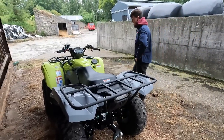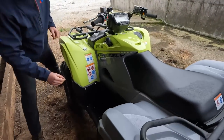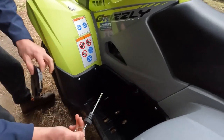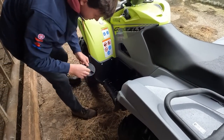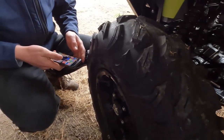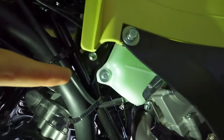And just then for maintenance, there's two things to keep an eye on. You have your dipstick in here. Right, just dip it there now while we're at it. Have it on level ground. We've this checked over. Perfect. Have it on level ground. Another thing then is coolant. So you see that tank in there? It's just the expansion tank. Oh, yes. It's just that one there.